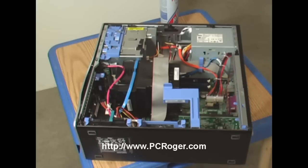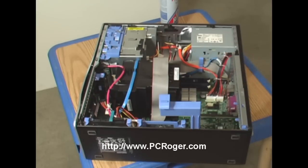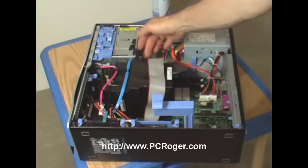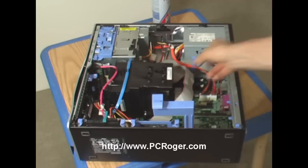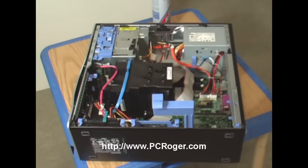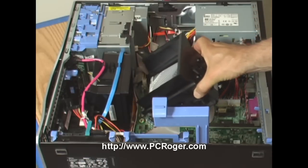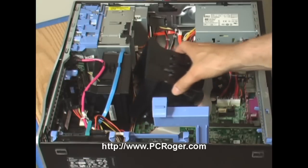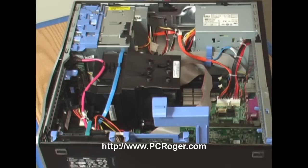Here's the inside of that T3400. This machine also has a fanless design on the video card — it's just a black heatsink with no fan, but you need to make sure those fins are clear. It also has a shroud, and this would only be for deep cleaning. There's a screw here and here, and you have to get the floppy drive cable out of the way if your machine has one. The shroud tips back so you can fully access the fan underneath and the cooling fins for the processor. Since these machines have no cooling fan directly on the heatsink, it is very critical that you get the air moving through at the desired rate of flow to keep the machine cool and prevent reboots and blue screens of death.